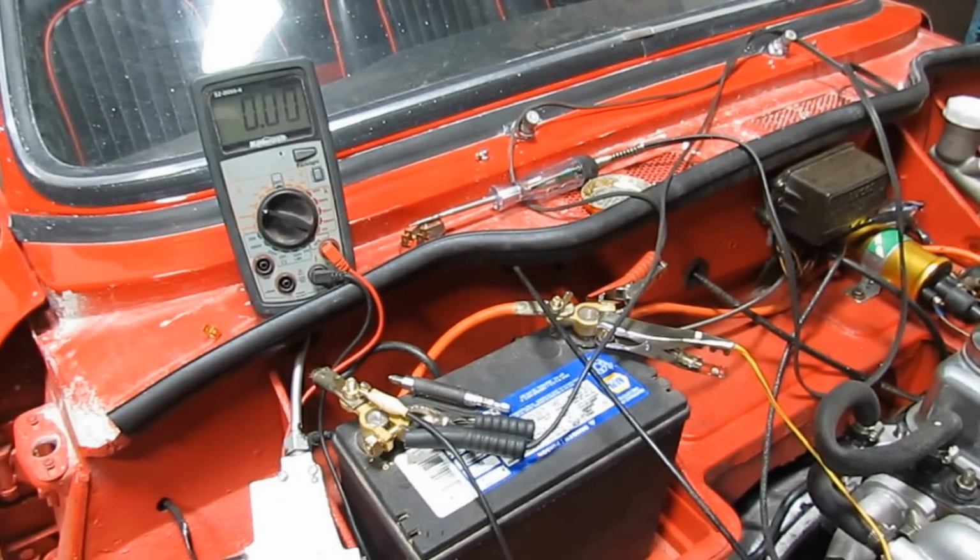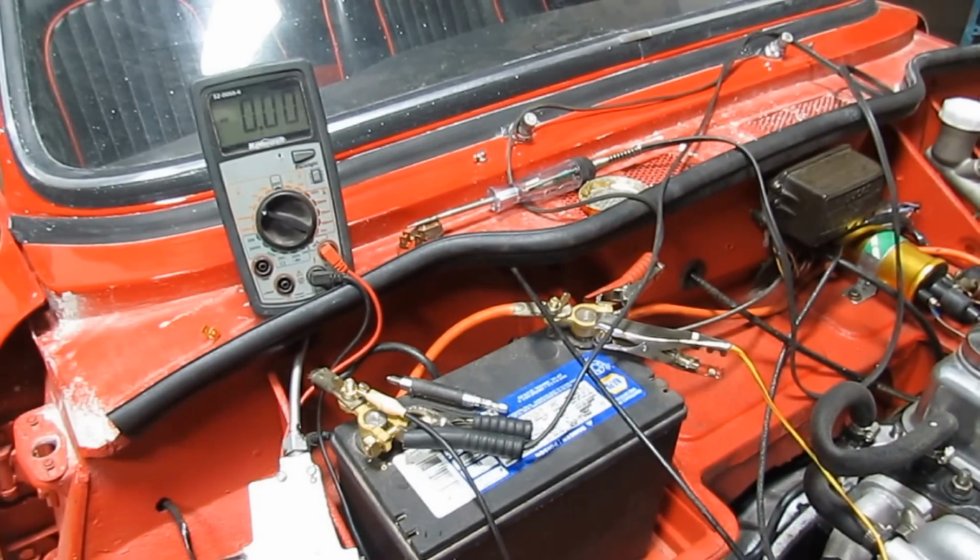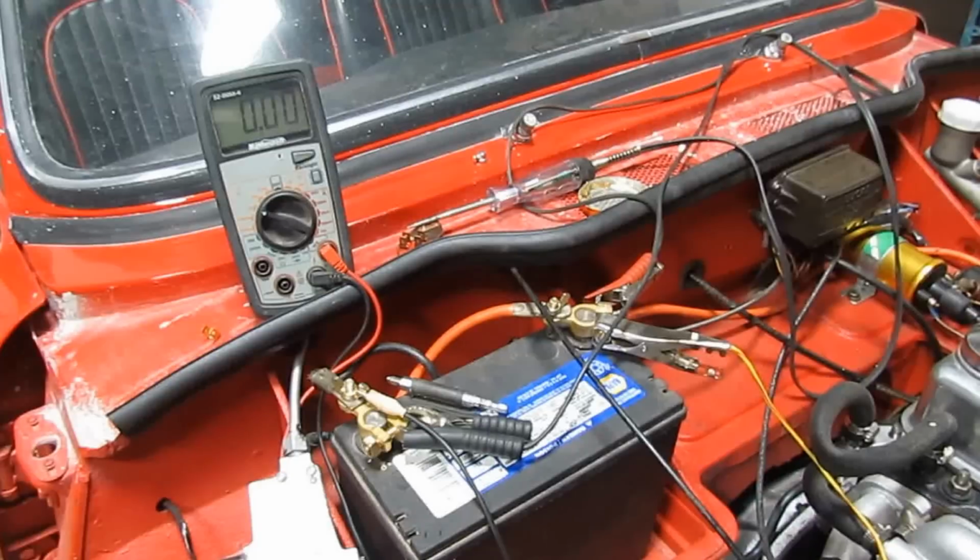Okay, so obviously I had to go back to my old voltage stabilizer and try and see what was wrong with it. So I went online and checked how it works, and it works like a switch with a bimetallic strip inside. When it has load on it, it becomes a little bit hot, and then the bimetallic strip bends and interrupts the circuit. When it gets cold again, it closes the circuit again, and so on and so forth. So when the circuit is closed, we have 12 or 13 volts, or even 14 sometimes, and when the circuit is open, of course, we have zero. Depending on the load, the bimetallic strip opens and closes at different times, but it always stays open or closed as long as is needed to average the voltage between 0 and 12 at 10 volts. With my English I can't explain it better, but I hope that makes sense.